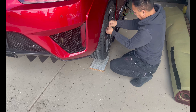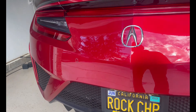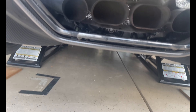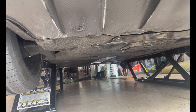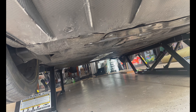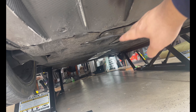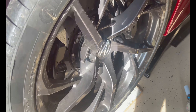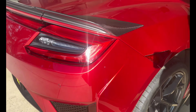First I took off the rims and then the whole rear bumper. Under here you can see the exhaust piping, and down here you see all the panels. These right here are the clips — you've got to take out all the clips before you do the exhaust because it's inside here. Everything has to come out, and after that we'll show you the inside of the exhaust. We put these little guides in so the wheel won't fall off, and we're gonna do the same thing on the other side.